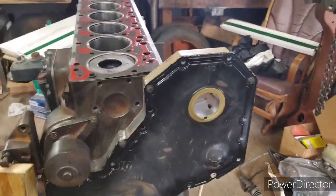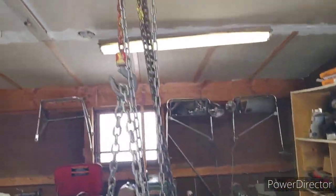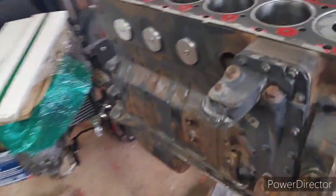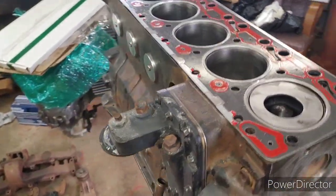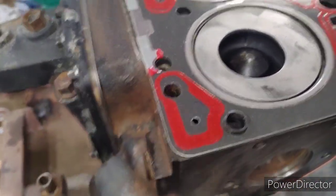I set the head down there on a block of wood. I've got to lift it up with the chain hoist. Picking it up and setting it on that head gasket's going to be treacherous. I think this head was machined flat. I wiped it with mineral spirits on a dry rag, and after I do that I wipe it with my clean hands, because I don't trust rags — they leave lint. This is a silicone steel gasket, so it doesn't require any permatex or silicone or anything. It's got a rubbery silicone coating.